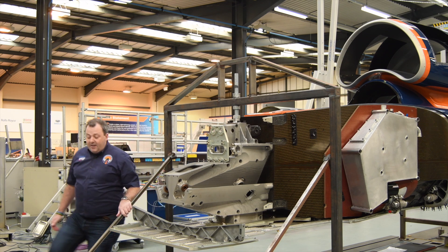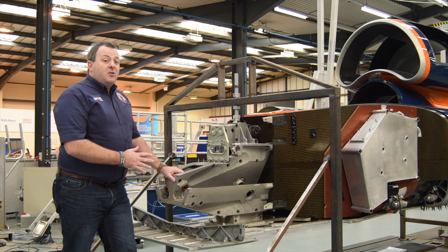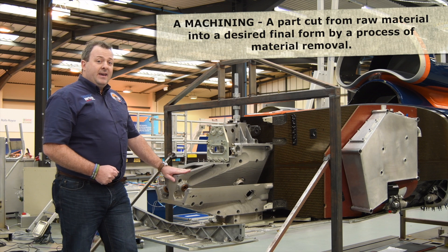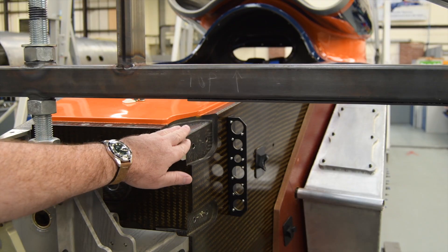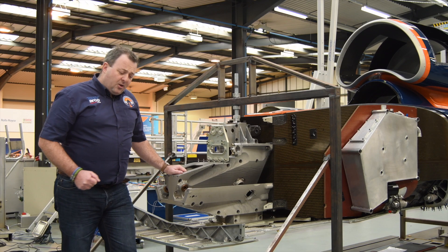I'm going to go through all of these again in full detail over the course of this series. Here towards the front of the car — the goat's head, the front suspension sub-assembly — four large machinings that had to fit together and then accurately fit to the front of the monocoque. And here at the front of the monocoque we add the key interface to the blade, which is the heart of the whole front of the car. Let's go look at the blade as well.